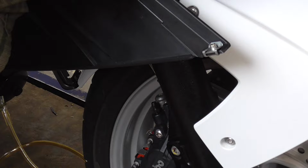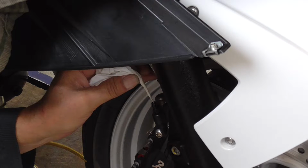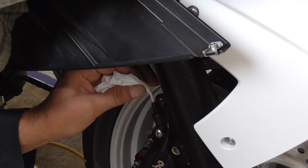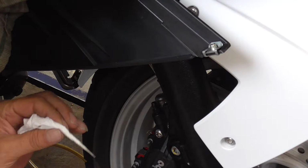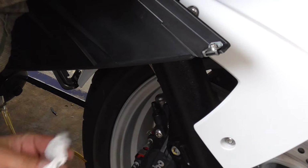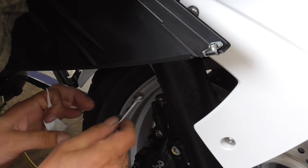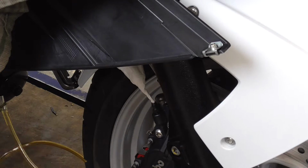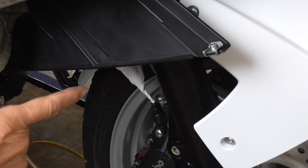When you have bled the brakes, there's always brake fluid in there. And I make this thing gently, get it in. And then, see? It flows out. Then have another one. Another one bites the dust. Let's see. Yep, fully closed. And this one I stick in and leave for a while. Gotta do the same on the other side.